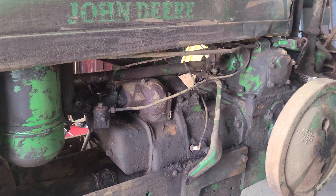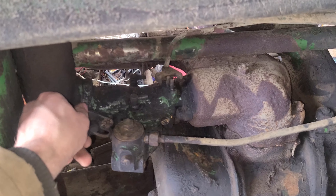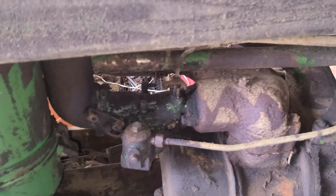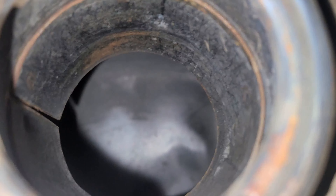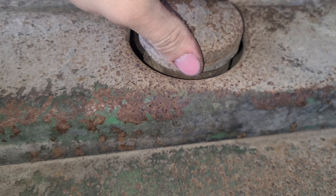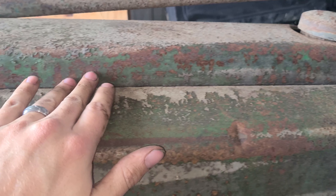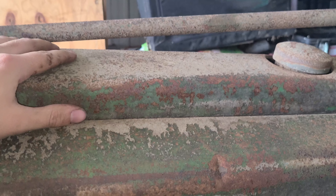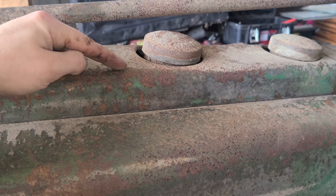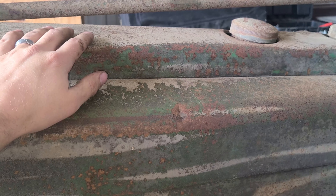You can check that the carb throttle shafts and choke are free. You can look inside the gas tank — it looks nice and clean here. However, there's a caveat: I've looked into tanks that are shiny inside and thought they were good, but they were actually all rotted out on top. Rain comes in, dirt sits underneath, and you can have a shiny tank with holes in the top. You really don't know what you have until you take it apart.